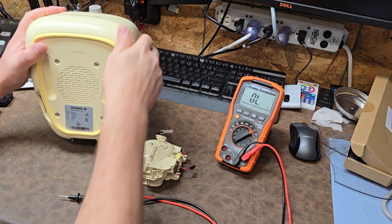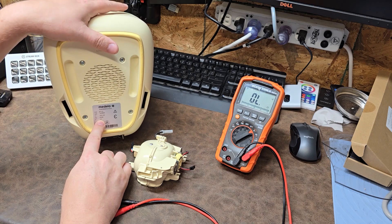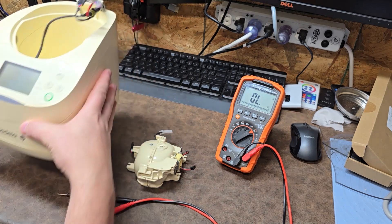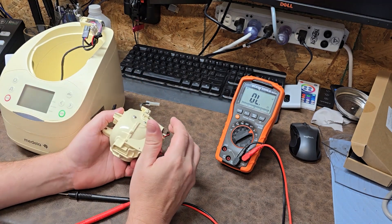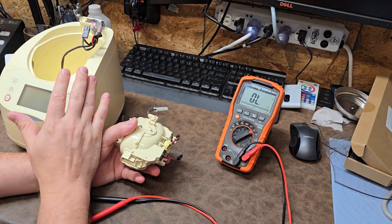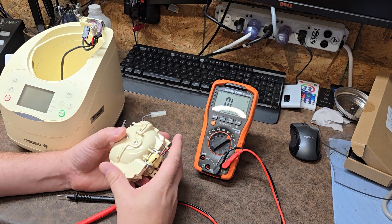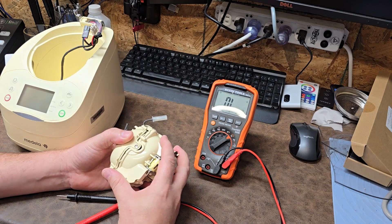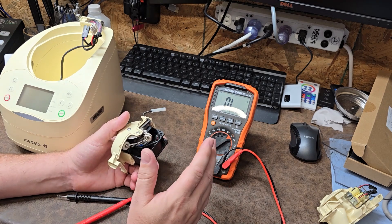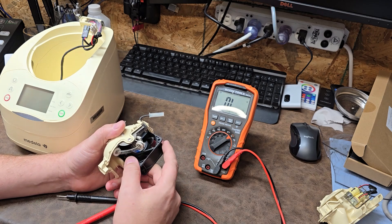It says it's 100 to 240 volts, 2.5 amps. So at 2.5 amps at 120 volts, if it was all on for this heating element it would have to be like 40 or 60 ohms - a pretty high ohms amount. If this device isn't heating up, we put our multimeter on ohms and check the heating element. If it's not at that 40 to 60 ohms and it's much lower, normally I'd say that heating element needs to be changed. But these Medelas are a little bit different - they're special.